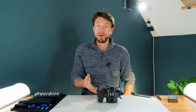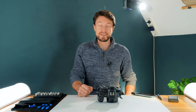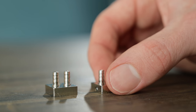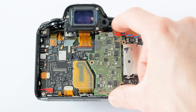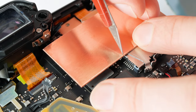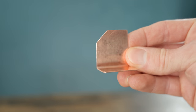To make sure any mod has a chance of working, I need to targetedly cool this area to see whether the camera then decides it's not overheating. To do this, I'm going to use water cooling. I'll utilise a couple of tiny water blocks from Alpha Cool, but because the power board has to clip into place above the processor, I can't attach them directly to it. So instead I'm going to use a small piece of one-millimetre-thick copper to make a rudimentary heat spreader to pull heat out from underneath the power board — copper is a great conductor of heat.